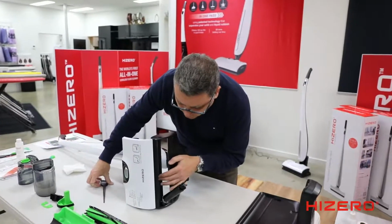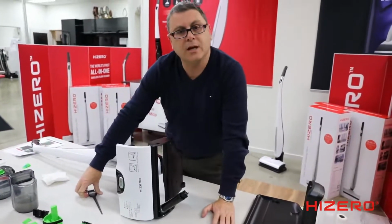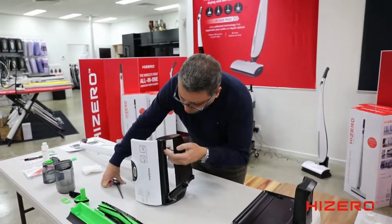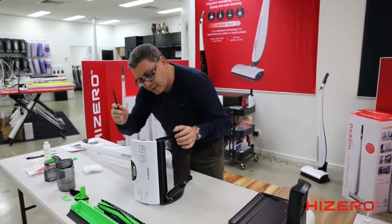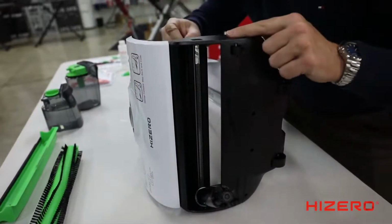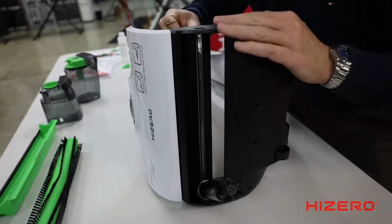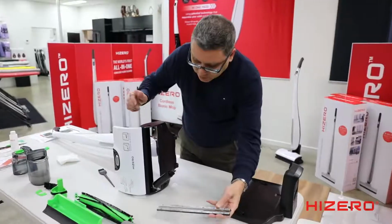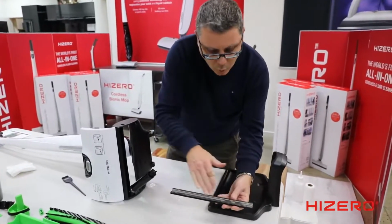Now, we also need you to remove the sink drain. It's like the filter in a vacuum cleaner. This is where all the gunk gets filtered, and there's a little drainage hole which takes the water away. We're going to show you that later. With the hole that we made by removing this, and the brush that we give you, use the brush handle, push out the sink drain, and it comes out. So this is the area that you need to clean. Give this a wash.